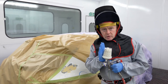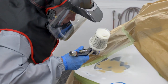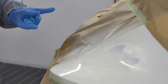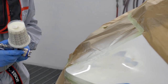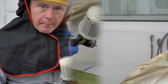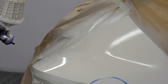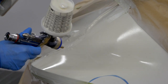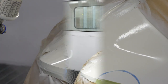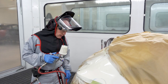I'm using a 1.6 gun and I'm going to drop the pressure to one bar. That's the first coat applied — a light to medium coat just to seal the surface. I'm just going to give that a minute now before applying the subsequent coats wet on wet. That's the application done and as you can see it was very quick and very easy and has left a very smooth surface.